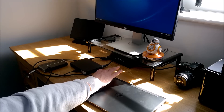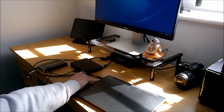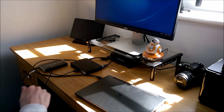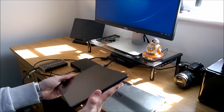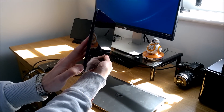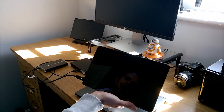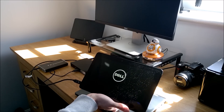In theory you could plug the dongle into one USB Type-C port and leave the other free for a charger. With this full dock everything goes through the one cable. I've also got one of the new Latitude 11 — the 11-inch tablet running on Skylake, the 5175 — which has USB Type-C. I disconnect the laptop, find the USB Type-C port on the tablet, and now that device is charging and picking up the video as well.